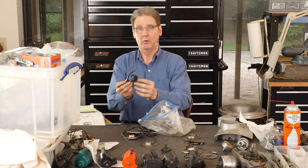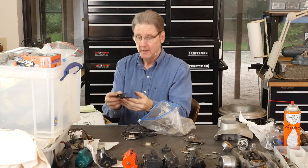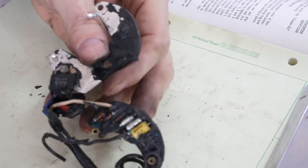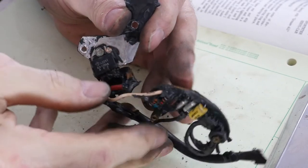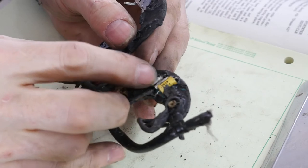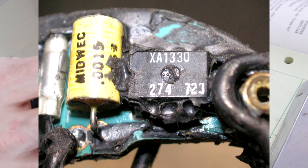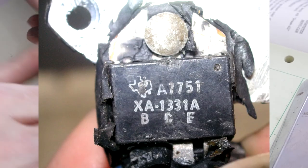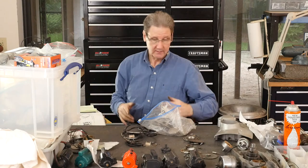Here's a little bonus footage — I was trying to design an ignition before I gave up because Crane and everybody else does it better. I broke apart a 79. You can see it's got a film capacitor there, probably resistors or diodes, a chip which I've never been able to read what it is — I'll look that up for you. And here's the power transistor, instead of the points. So all that being in the module, it can work. But good luck.